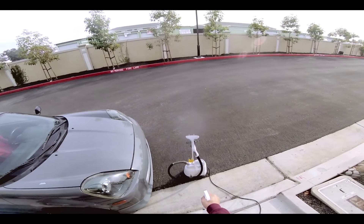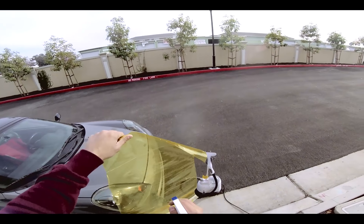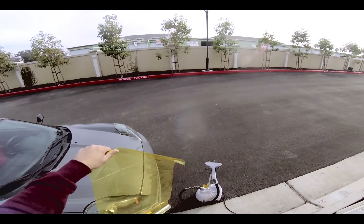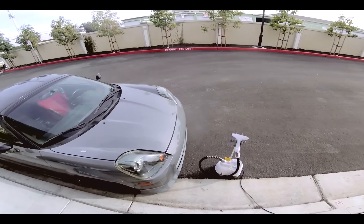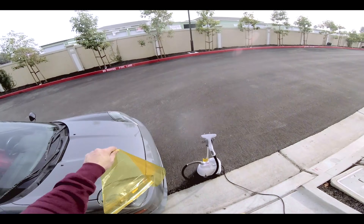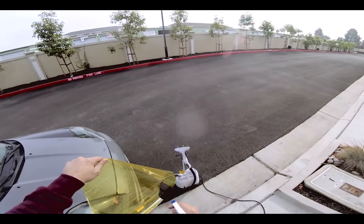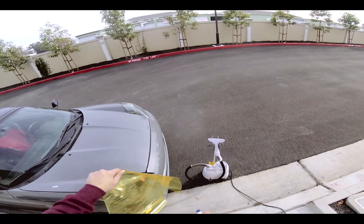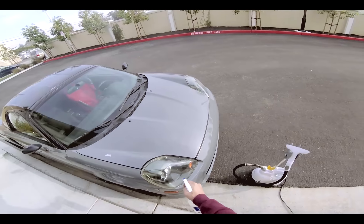What I have here is a steam cleaner. I'm using a steam cleaner to help, instead of using a heat gun, because a heat gun will activate the adhesive and it will ruin the film — you might even end up with adhesive stuck on the headlight. With this, it's going to help moisturize the film while it heats it up enough so you can stretch the film. It keeps it moist and does the job of heating it up, helping it to stretch around the curvy headlights.